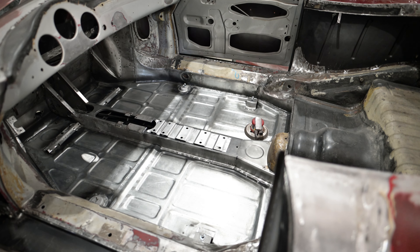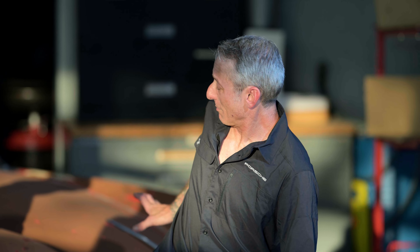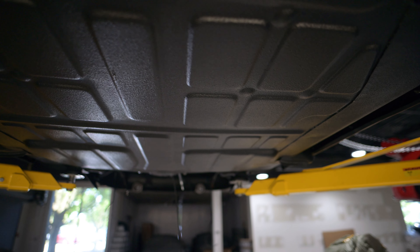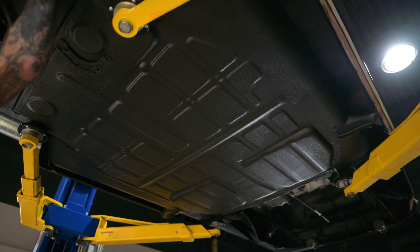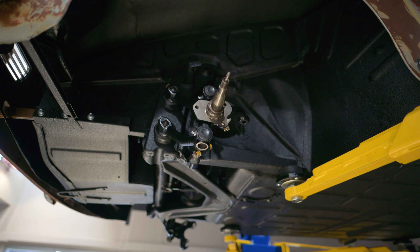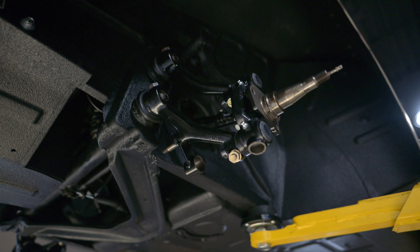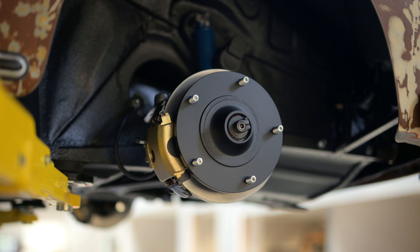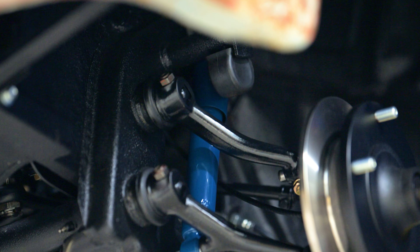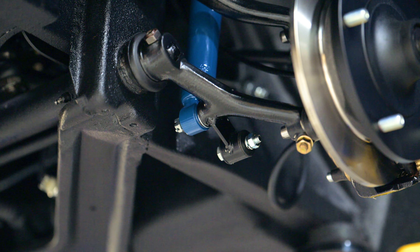That's impressive. And it was done with the body on the car. All kinds of bracing was put in place to keep the car the way it should be. We have new sheet metal from the front to the back. The suspension components are all original — they've been powder coated, with new kingpins, new bushings. The wearable parts were replaced. Up front we upgraded to disc brakes, the back has the original drums, shocks were replaced, and spring plates were replaced. There was a lot to do underneath the car.